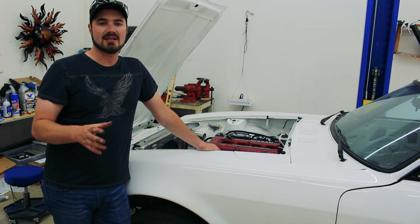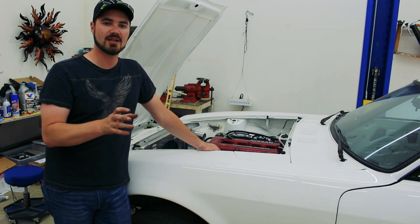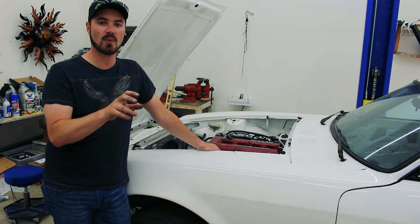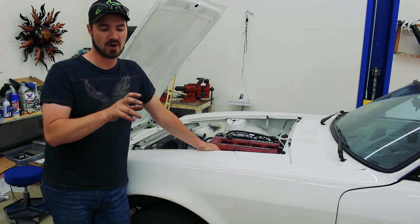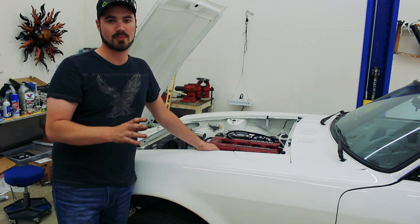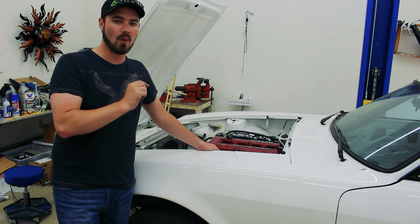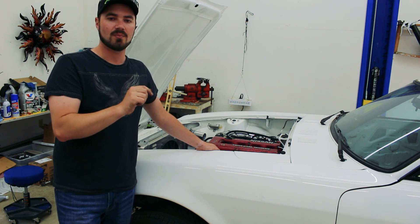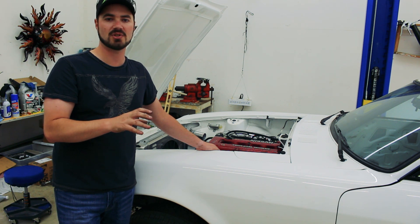As you can see, installing the CAS in the SR20DET — specifically an S13 — isn't that difficult. The most difficult part is that as you slide the CAS in, you may end up being off by one tooth on the cam, which will cause your dots to shift over. Potentially the only way to get them back into alignment is by turning it to an extreme — either so far that you can't get bolts in, or so far that it's maxed out on the bolts with no adjustment room. In theory, the car won't start, which will also tell you there's a problem. If that is the case, you just need to play with turning it slightly when you get it lined up and pushed into place, or you're off on the front of the engine on the pulley and just need to drag the pulley back to a different mark. Rub off your marks, make sure there's not one more full of dirt that you're missing, but otherwise this is a pretty simple process and you shouldn't have much difficulty doing it.